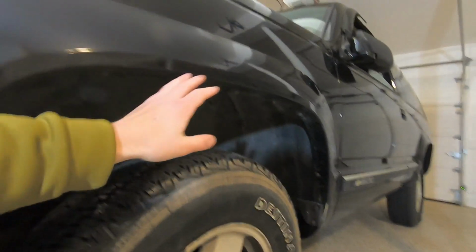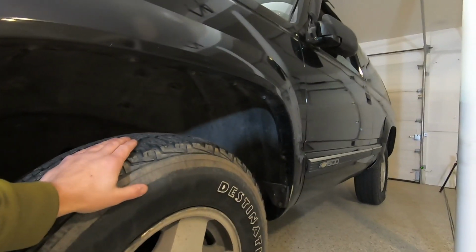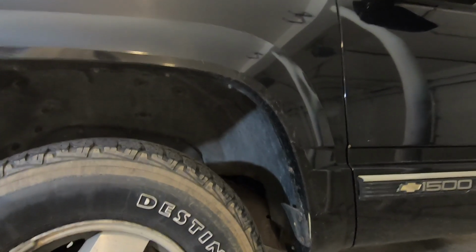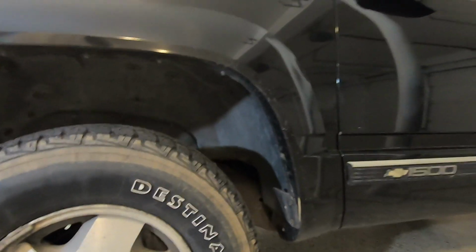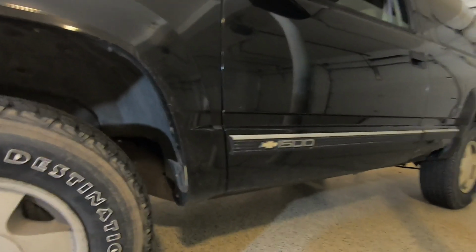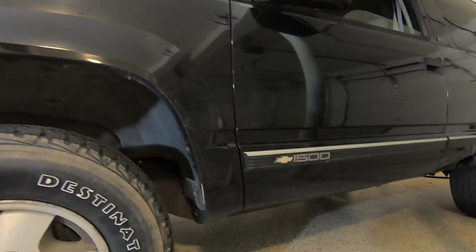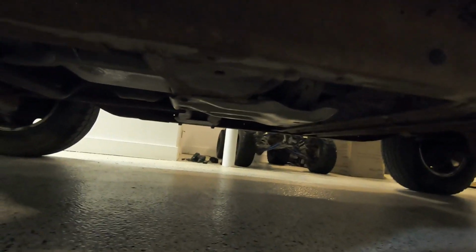So I don't think it's gonna fit on the stock suspension. I really don't. I don't think we're gonna have enough clearance. I'm gonna try to stay away from a leveling kit because we can raise the truck for free. Leveling kits, I'm sure you've seen them online. Like for this truck would be a torsion key. It's a little circle with a triangle on the end, a torsion bar key, and that is going to just allow you to crank these bars up farther.